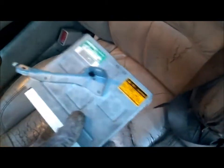On this Lexus GS300, I'm going to be installing a used ABS VSC computer. First thing I have to do is go up under the dash and remove this black cover. On this one there are two screws here and then this snaps on in the back, so I have to remove that.